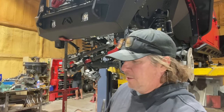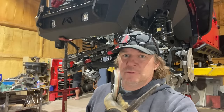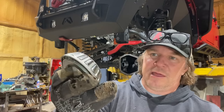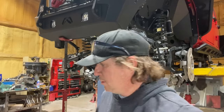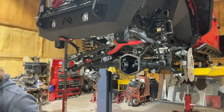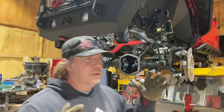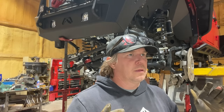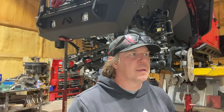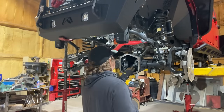So behind the flange where the drive shaft attaches to the pinion, there is a seal. The pinion sticks out this way and then the drive shaft attaches there. And behind that seal is the outer roller bearing for the pinion. So all of the shims are underneath the races, correct? Underneath the bearing, actually, not the race. In some cases, though, like a Dana 35 often shims behind the race. This particular one shims behind the bearing.